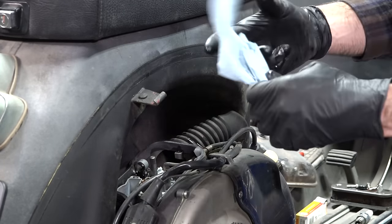The next thing we're going to do is start the scooter again and make sure the battery is charging. It starts nice and easy, no issues with the engine. I go back and look at my meter — the smoke cloud — and I want to quickly check to make sure I'm charging. 12.85 volts, already coming up. If you rev it, it should go even higher — yep, over 13 volts. This thing's charging good, no issues there. If you don't have a kill switch, you can hit the brake, shift into gear, and let the clutch out to stall the motor.